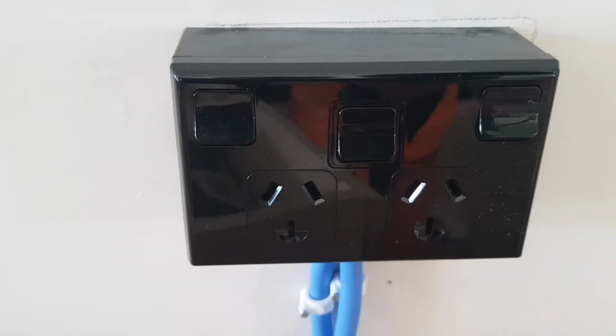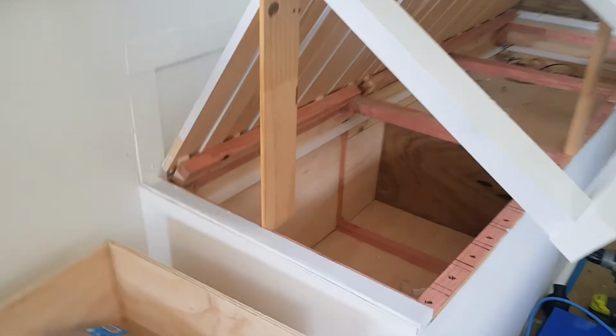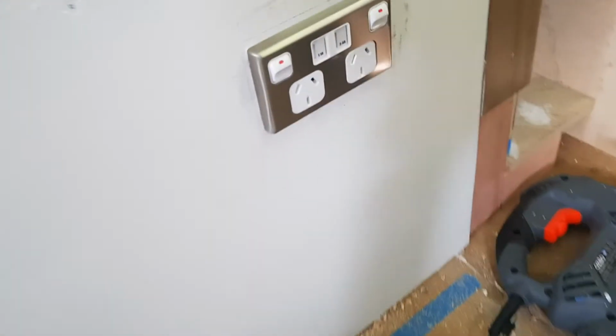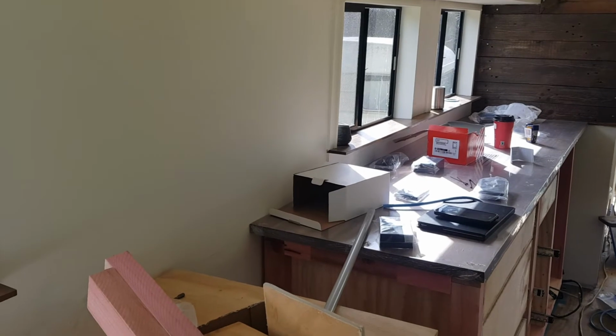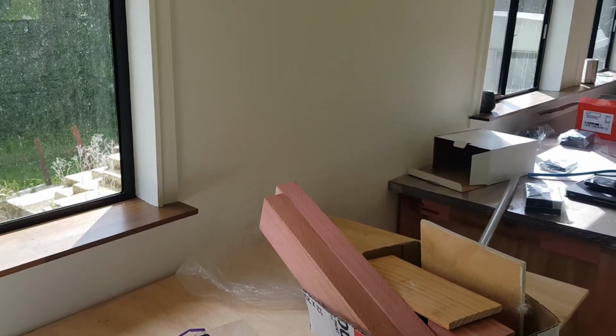So we've got the socket down there that's got the fridge isolator. Got the fridge socket up there. And I've run cabling and trunking underneath the bed. Got a power point there for charging. That comes around the front as well. We've got power point on the front there, double USB. And so now it's time to get into the main kitchen area. And we're going to get all that sorted out. Get the power into that, and then do some testing, finish the board, and we're done.